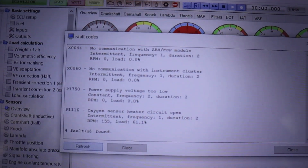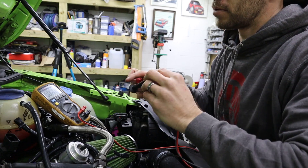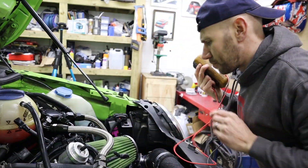The car started, which was a bit dramatic! But the lambda sensor didn't look like it was reporting, which was one of the really important ones I wanted to check. I got into fault codes and there's a code for the heater element open circuit on the lambda sensor. The last ECU wasn't reporting a problem with it, so hopefully it's not serious — I think I do have a spare though. Let's go have a look. Yeah, the heater circuit's open on the lambda sensor, no wonder it wasn't reporting. I'm pretty sure I've got a spare one — bear with me two ticks.